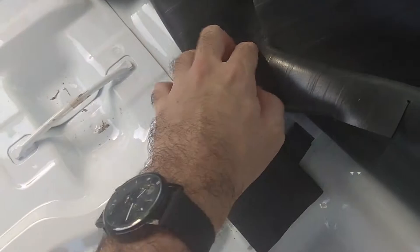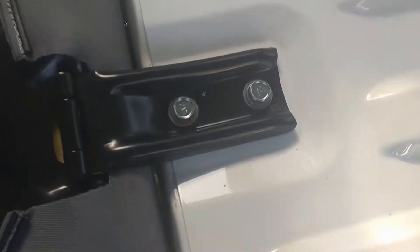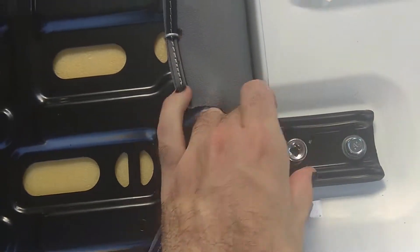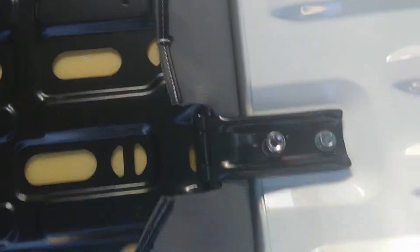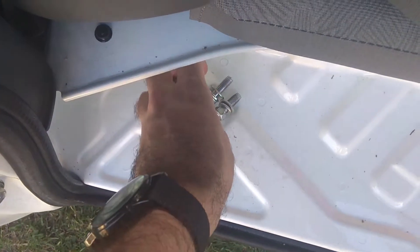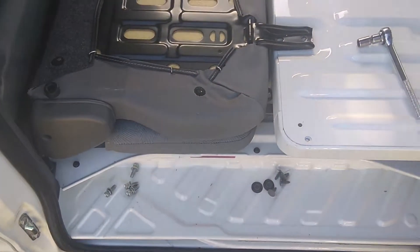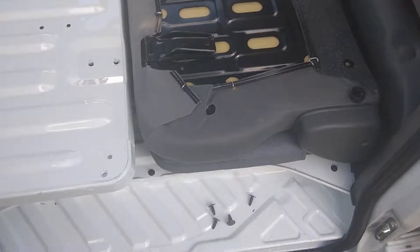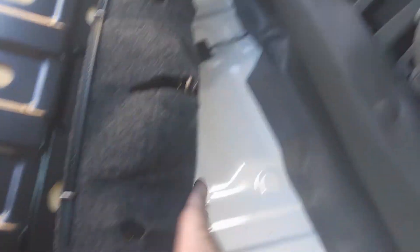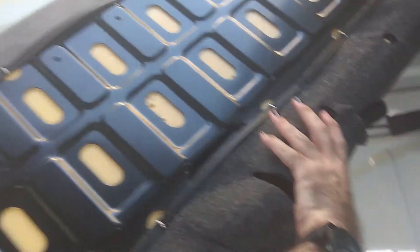Now just peel the plasticky thing back, trying not to rip the seat belts off. Seat belts are kind of hard to deal with because, for some reason, they just are. Now you just want to take off these four bolts holding down the seat — they're going to be 12mm, so I recommend using a driver of some description rather than your fingers. Once you've got all the bolts out of that seat, put them somewhere together where you won't lose them. Pulling the seat out isn't particularly hard at this point, it's just super awkward — made worse if you're trying to hold it with one hand and film with the other.